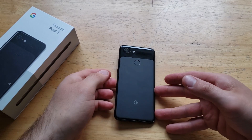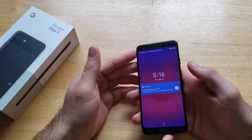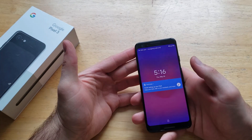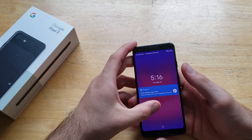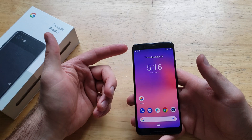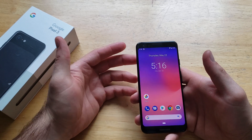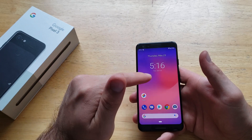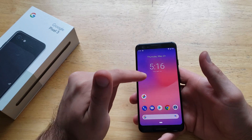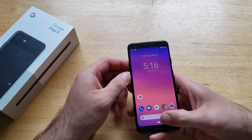The first thing we're going to want to do is find the IMEI number. On some older smartphone devices it's written somewhere on the back, but I strongly recommend going into the actual device itself and checking it there, because cases and phone bodies can be changed around. Whatever's inside internally is what's going to be reported lost or stolen. This is the way I always check mine.